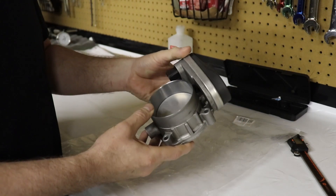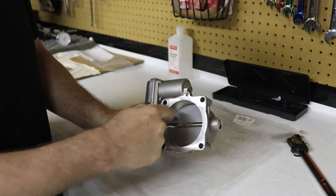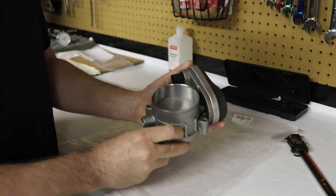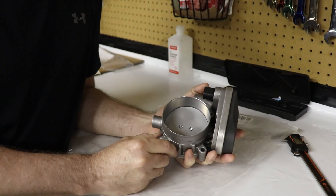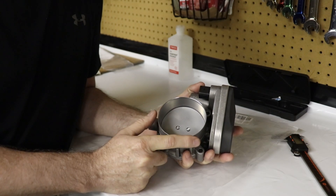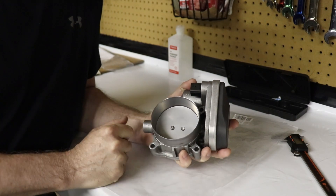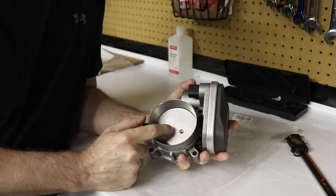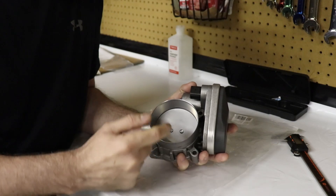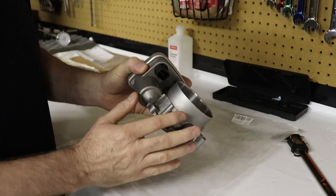This is his 84 millimeter, where he actually bores this thing all the way through and installs a new throttle blade. One thing I really like about his throttle bodies that you don't see a lot of companies do — they remove the front of the shaft, which gives you four millimeters more area. He also uses a nice smooth button head screw, whereas some bigger name companies use what looks like a big flat Phillips head screw sticking up, which can't be good for airflow.